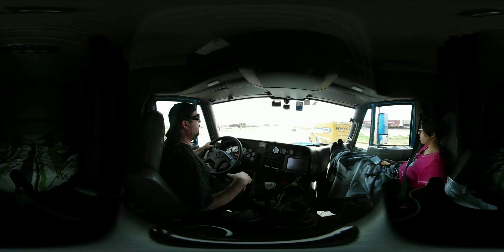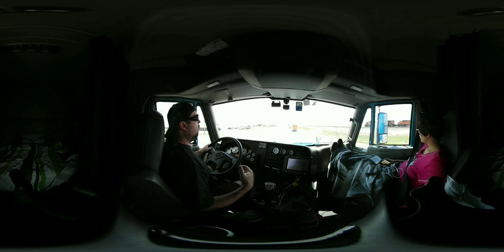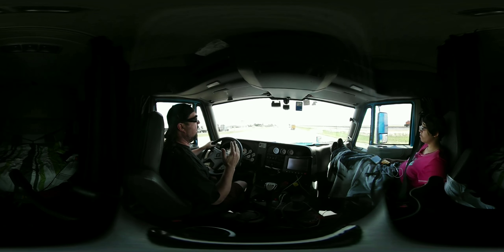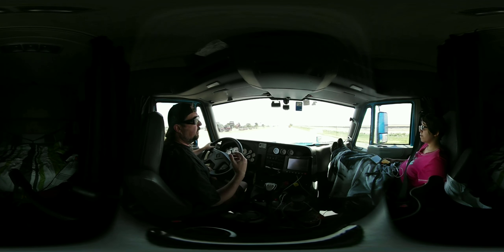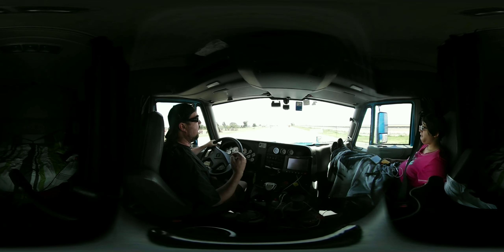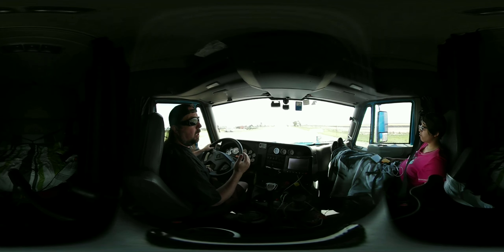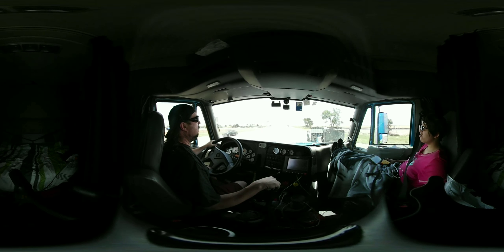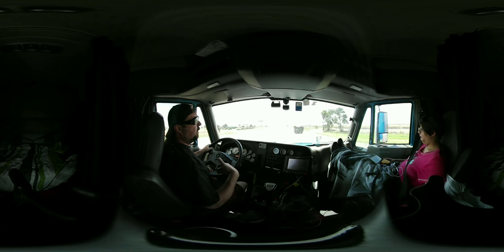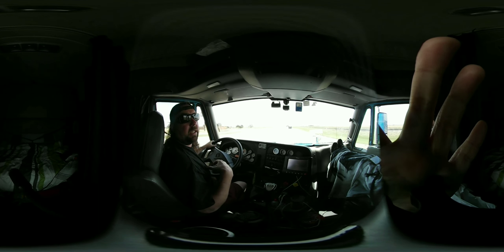Now you're in your top gear and you're still building up speed. We recommend that you shift the low range between 900 and 1,000 RPMs on flat ground, get it up to 1,100 RPMs if you're climbing when you're taking off, especially with a heavy load, and shift your high range gears at about 1,100 RPMs. You may need to get up to 1,300–1,400 RPMs if you're climbing with a heavy load while accelerating. But that's the basics of shifting — really quick, I know, but you'll see more as we go along to the next videos. Once again, thank you.